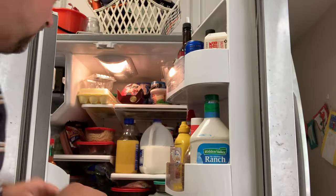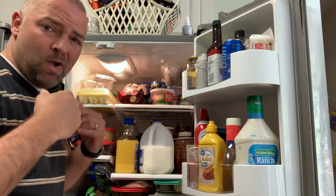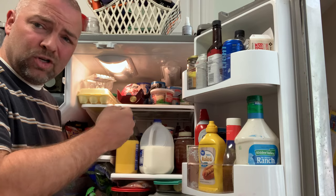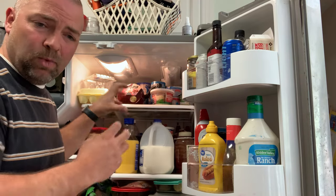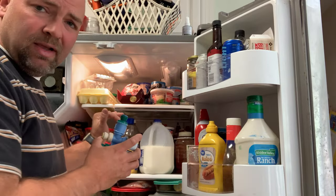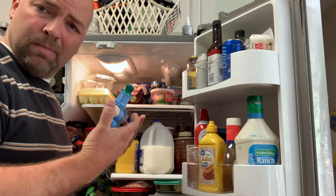The first step is a bit of a hassle — I've got to get all of this stuff out of my fridge. So we're going to do that in fast forward. Then I'm going to shut the water off, turn the power off, take the filter out, pull out the back panel, and then we're going to pop in this water filter and exchange the tubes. Then we'll hook everything up, make sure we've got water pressure coming out of the front, and then we'll hook our ice maker up and it'll be up and running again.